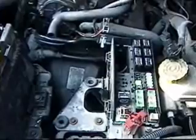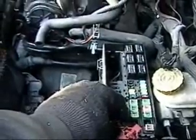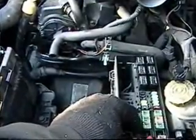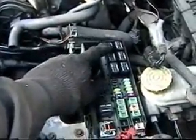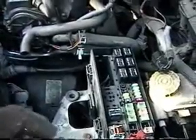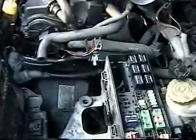With the low side relay open and switch hit, we've got power to the fan — the fan works on that side now. Before testing, the high side had power but the fan wasn't coming on the low side — it had power to the connector but the fan wasn't working. This repair solved that problem. Now I'll finish putting the engine back together, bleed the cooling system, and give it a test drive.